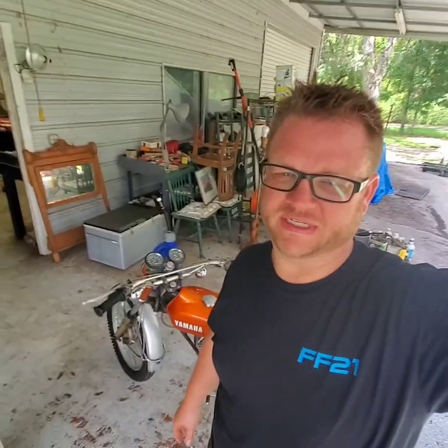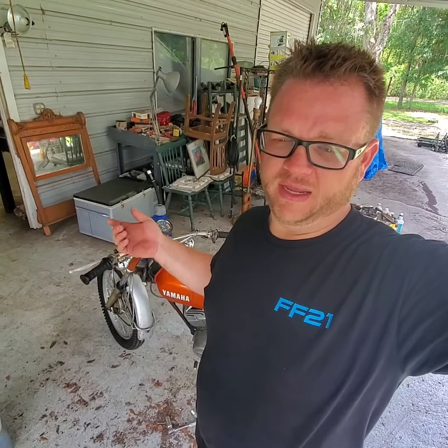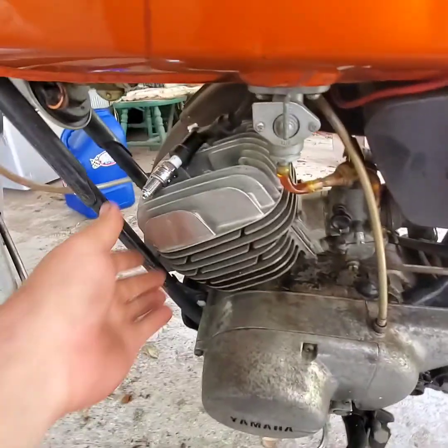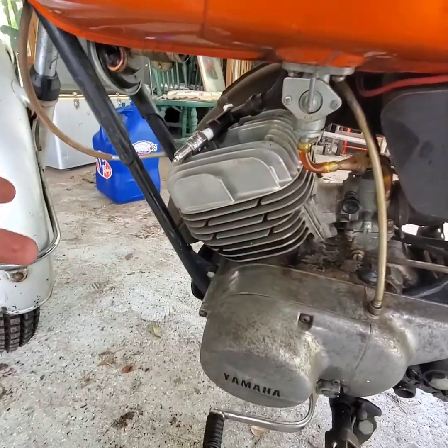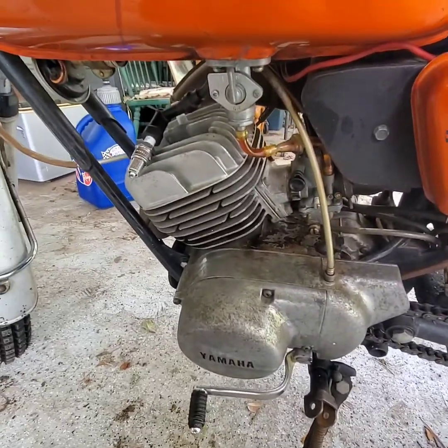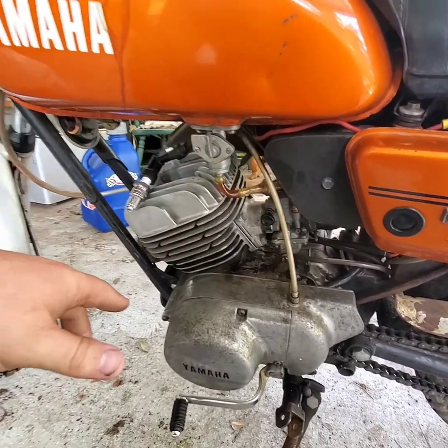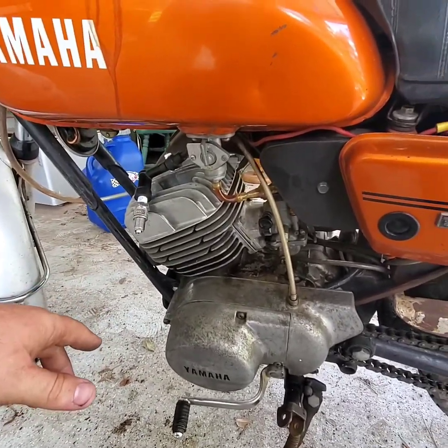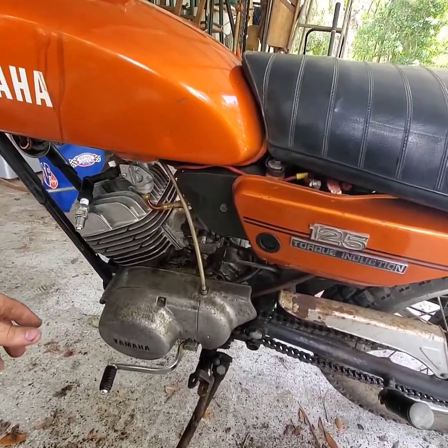We have to accept defeat for today. The bike had spark earlier and I couldn't get it started by kicking it, so we thought we'd pull it behind the lawnmower — that didn't work either. The cylinder was starting to get a little bit of heat in it, so I felt like it was trying to fire occasionally, but no luck. I came back, put a new spark plug in, kicked it over — no spark. We've lost spark somewhere. There are a couple of questionable ground wires under the seat. We're going to have to dive into this at a later date. We'll put this in AC storage, diagnose it, figure out what's going on. We may even go ahead and order a new coil and wire harness just so everything's 100%. We'll get to hear it run at a later date. Thanks for watching Junkin' with Junior — see you next time.